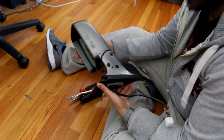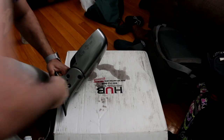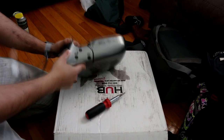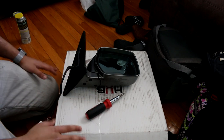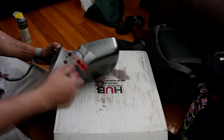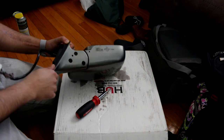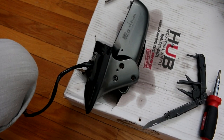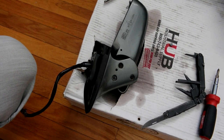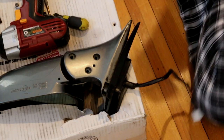We're going to take these three screws out of the back — three Phillips head screws here. New strategy: don't do what I just did. I ended up stripping one of the screws. Chances are if you're doing this, you're going to end up breaking one of these Phillips heads inside the hole — they're actually Lock-Tited in there.